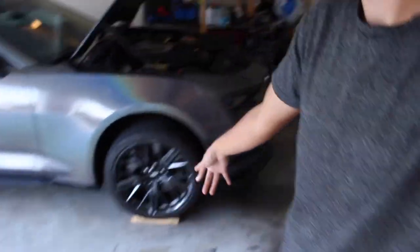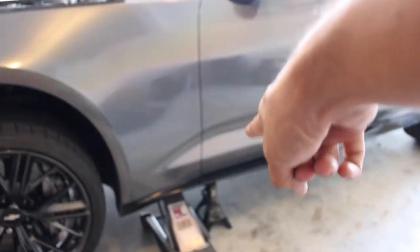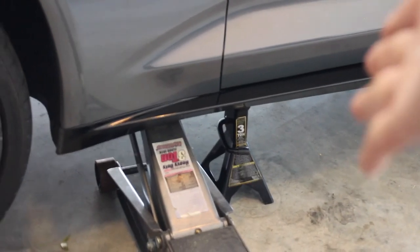To actually do this process, we're going to take the wheels off the car themselves, so you already know we got to jack it up. I already got this side jacked up and pretty much ready to start. Remember, you always got to loosen your lugs before you jack it up, then jack it up and take off the lugs completely. Always have a jack stand, just in case — you never know. We're going to take the wheel off, take it outside, rinse it down, clean it, and I'll show you all the products we use.